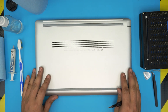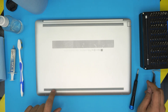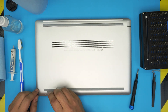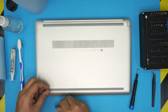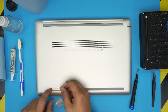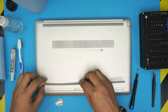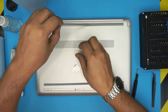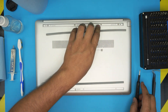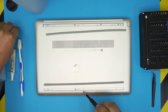First, remove power, flip the laptop upside down, and we're going to remove the bottom cover. Remove the front rubber cover and the back rubber cover — they have a lot of adhesive. Stick the opening tool right underneath and lift up the rubber with the adhesive attached. Put each one to the side once removed. There are two types of screws: the long ones and the short ones. The two short screws are the exposed screws at the front end of the laptop — remove those first and put them in one pile.